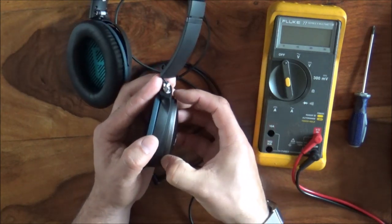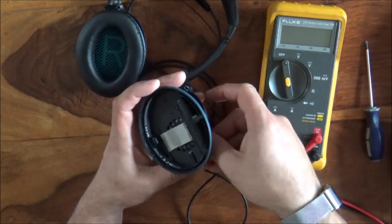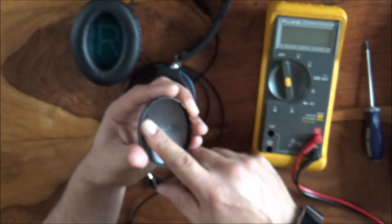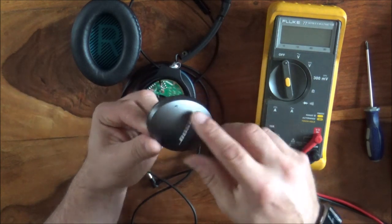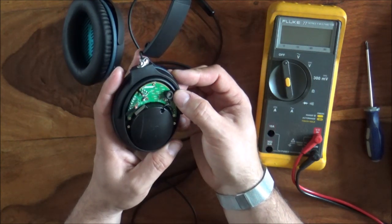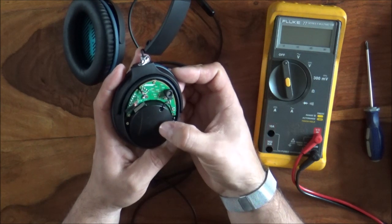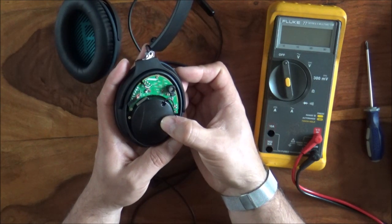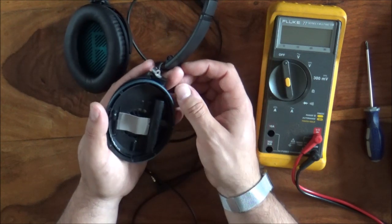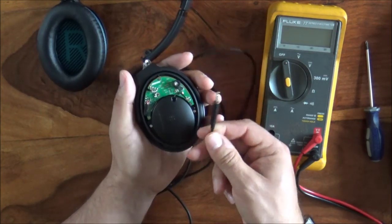It's a little fiddly to get off. The back is made of metal and it's got a little seal in it — you can see here a little hole which aligns with this microphone, which has a little seal over it. That microphone is listening to the noise outside the headphones and playing an element of that noise back out of phase with the speaker in your ear — and that effectively is how they do the noise cancelling.